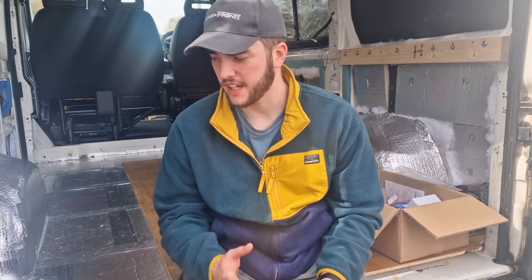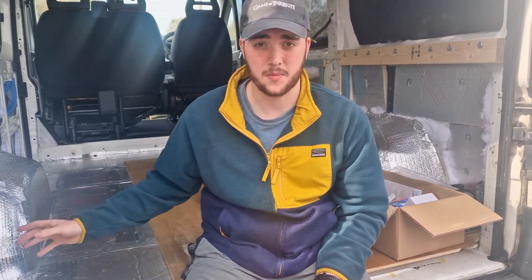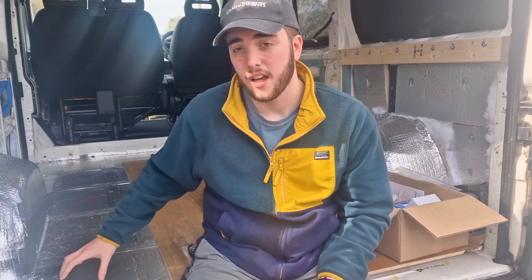This is going to be the start of the electrics video. I assume this is going to span across maybe even a few months, and it's going to be a long one so I hope you're ready for it. You may be looking into the van and thinking I put a subfloor video up weeks — months ago — and you are right. The subfloor was down, but in order to put the DC-to-DC Victron Orion unit in, I decided to pull the floor up and basically run the 16mm cable from the van battery to the leisure battery, which is going to be terminated in this area through the floor.